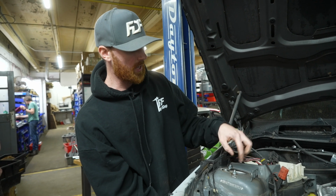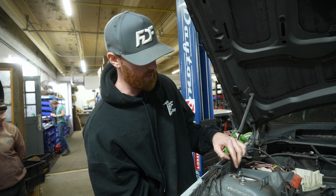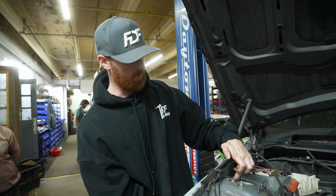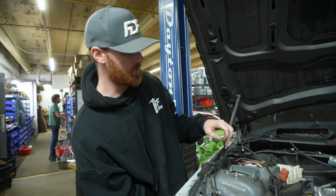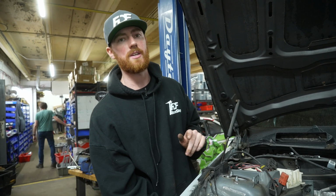And then the spacer that you saw on top of the plate, the spacer is designed to give you clearance to the tower's sheet metal so that you're able to do this movement. Otherwise, the plate is too wide and it would be hitting the radius of the sheet metal here on the tower. So that's what that spacer's for. We're gonna leave that loose for now while we start installing the rest of the components.